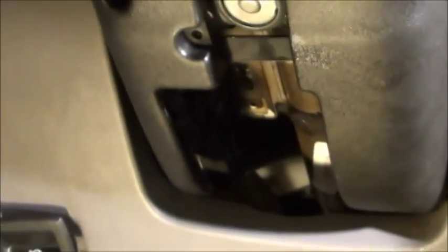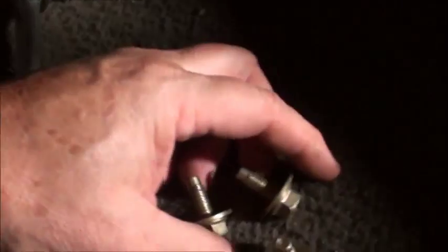I think now the time has arrived to go ahead and bolt up the steering column. As you see now, that's free hanging. I took 4, I think they're 12mm bolts, to put that in. Let me work on that right now. Those are 12mm. Alright, let me show you how that worked. I've got 4 of these 12mm bolts that, let me show you where they go. Up here.